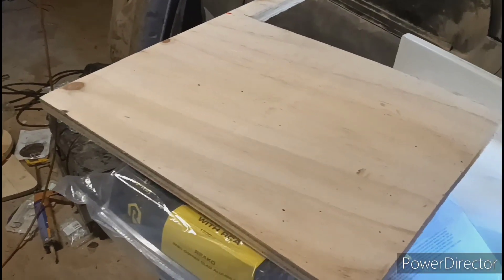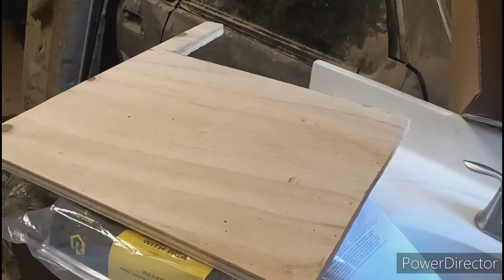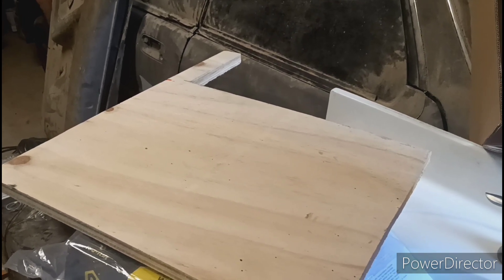I'm going to try to make some three-quarter-inch thick rings and put them in there and see if we can get the new subs in. I got hopefully enough three-quarter-inch material — I got this sheet right here, I got my little pattern over there. Hopefully one three-quarter-inch ring will be enough on each sub to fit — it's really really close. I might take the grinder and bump into the bottom of the box just for the vent on the bottom of the magnet, just to get that little extra clearance.